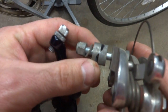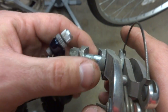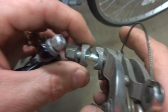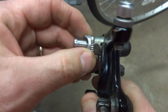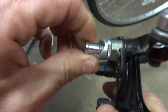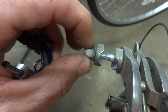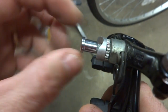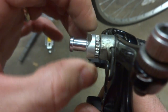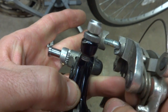For a close-up of what these look like: this is an older style brake with a nutted mount. This is a rear brake and it's got these little washers here that fit over the little brake bridge. And then this is a newer style here — it's got this recessed nut. On the older style the nut fits on the back side, whereas on the newer style this recessed nut actually fits inside with only a little part protruding out. So the bolt is significantly shorter on the newer style brakes.